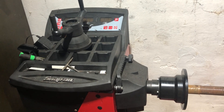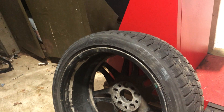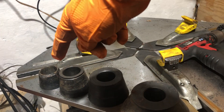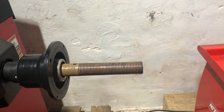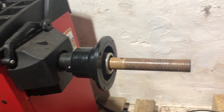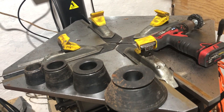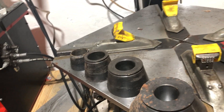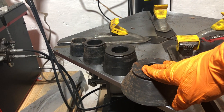First and most important is picking the right cone. Most machines come with three, maybe four standard cones for centering the wheel on the shaft. Most machines now have a 40-millimeter shaft — that's what you want. The old ones were 38-millimeter, but pretty much everything now is 40-millimeter, so I would stay away from the 38. You've got the centering cones, and you have to pair the right one to the wheel.